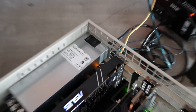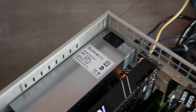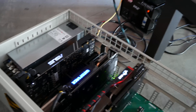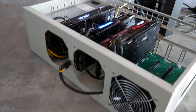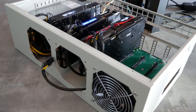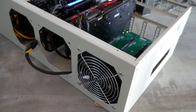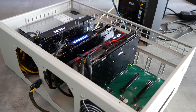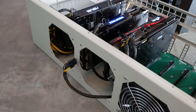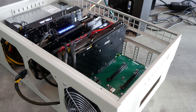Here is the power supply — up to 1600 watts, so you can definitely run eight video cards. What I do like about this miner is that the three fans in the back are super powerful, very similar to the S9 and S7 fans. They run at about 2 to 3 amps and can really cool down those video cards well. I removed them to fit really big video cards, but even with one installed they can cool down the whole system.